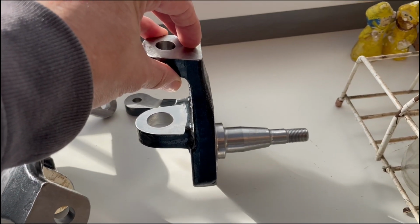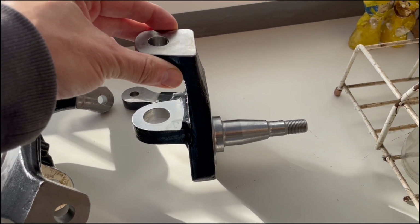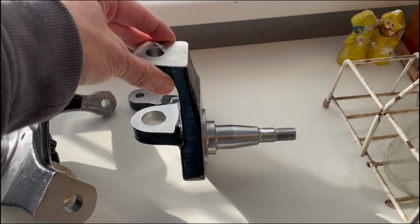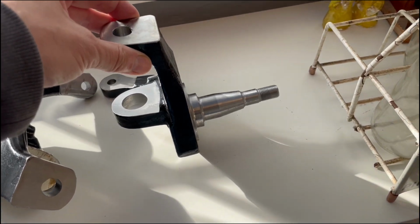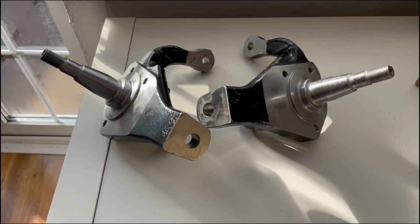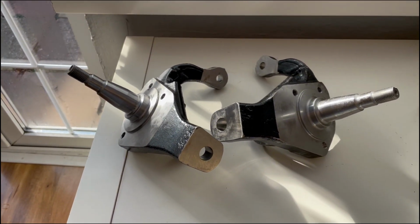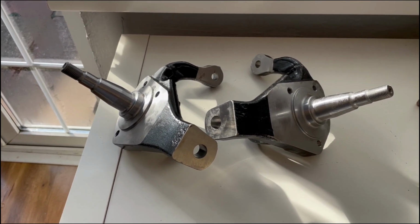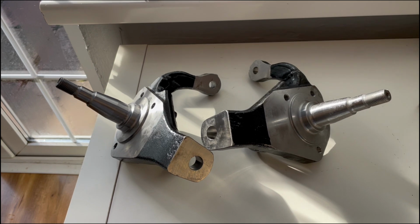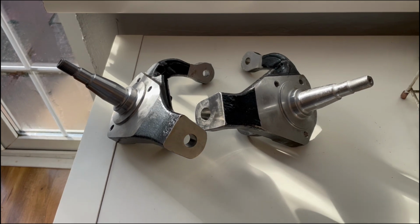So it sticks your wheels out, even if you're running standard wheels, which I'm going to run, original steel Sprint Stars with these. The steel Sprint Star has a similar offset to a standard wheel, but it still pushes the wheels out. And if you're in the know, you can always spot a car with standard drop spindles. It just sticks the wheels out, and this is one of the reasons why 2-inch narrow beams have become really popular. But when you start getting into fitting a 2-inch narrow beam, you've got to buy the beam, you've got to buy the narrow torsion leaves, you've got to narrow the track rods, you've got to get someone to do the job. And if you're not that experienced, it feels like quite a big job to do.